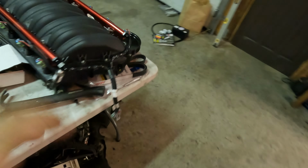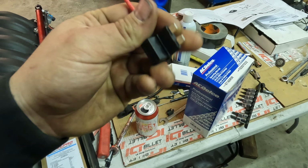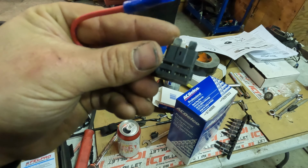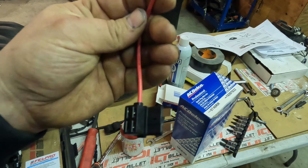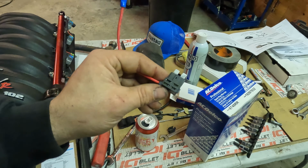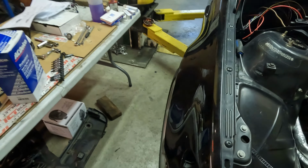And yeah, super simple. I'll show you what these little fuse doublers look like if you've never used one before. I think they're great. You can probably get them at your local automotive shop, it's just a little Pico product of some sort. Basically you plug that into a fuse, and then you get two. So you get a fuse for the thing that you stole from, and another fuse for whatever you want. And whatever you want has this power thing here. So this is what we're going to use to hook right up to our switched power in that fuse panel. Super clean. Everything's fused. Everybody's happy.